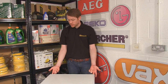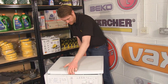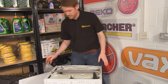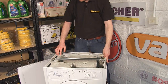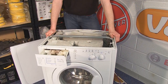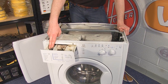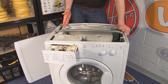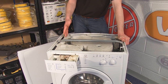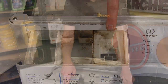I've unscrewed the top, so I'm just going to take the top off for easier access. Here we have the detergent dispenser and soap drawer. The soap drawer is split into three compartments: the pre-wash compartment, which has its own solenoid valve; the main wash compartment, which is also fed by a valve; and the conditioner or fabric softener compartment, which is fed by both valves.